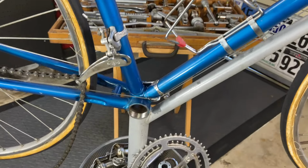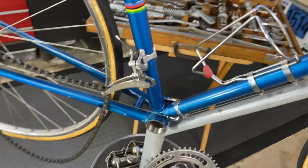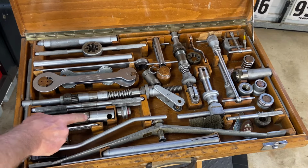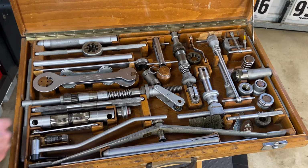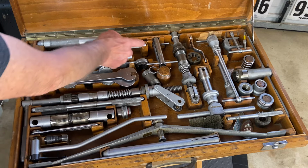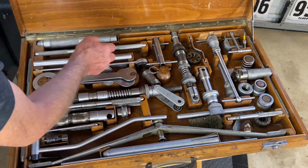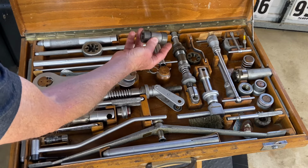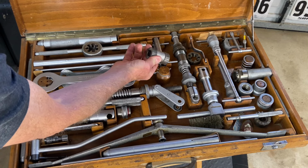In the bottom bracket, of course, you screw the cups in. It's threaded on both sides. The tools we're going to use take up a good part of the kit. Here's the taps to chase the threads here, and those are the handles for them. And then over here are two tools for driving in these holders. Basically, it's a guide or a pilot.